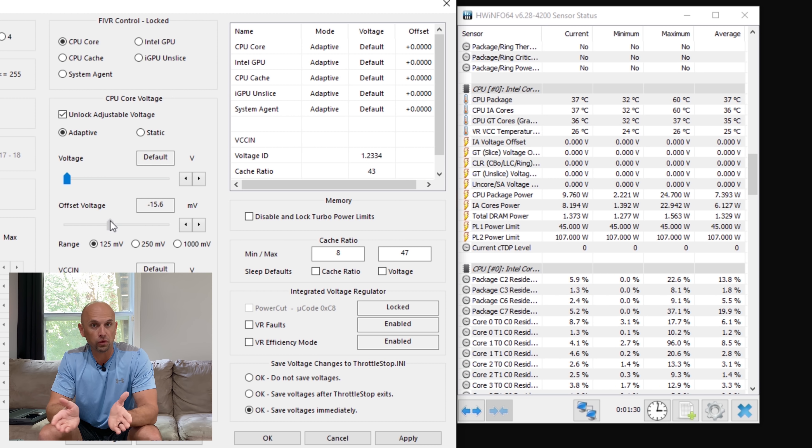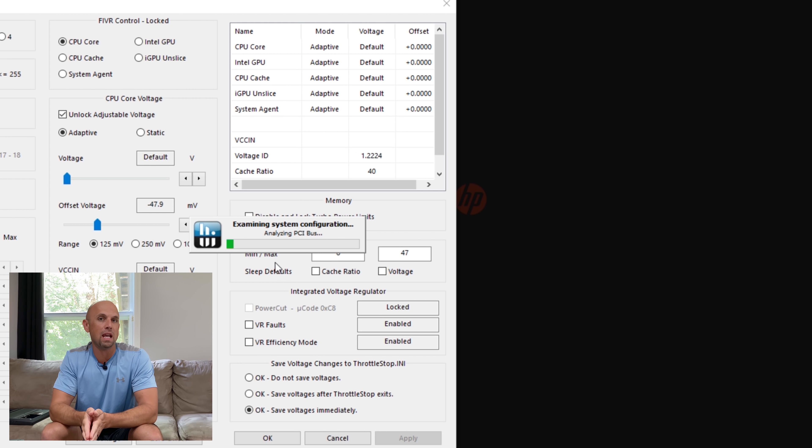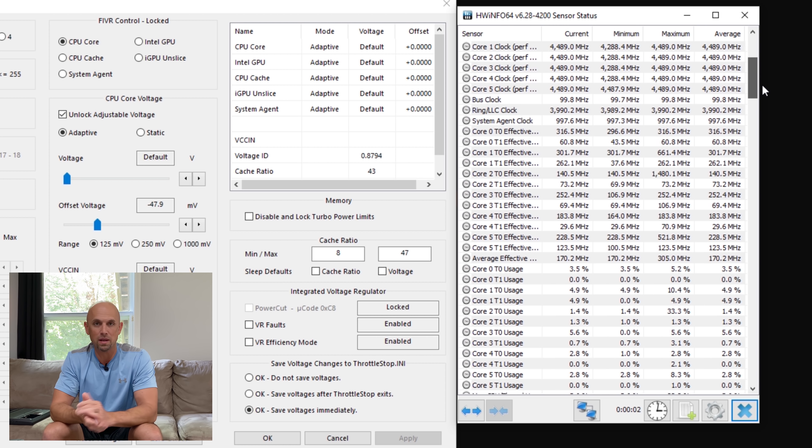So here's a few things that you may want to try doing. Try downloading Throttle Stop — I have two tutorials covering this on the channel, and I will link those in the description below and at the end of the video. Within Throttle Stop you may find undervolting sliders, but you may be able to move those all over the place and they just don't do anything. That is the case on this HP Omen — it is locked out of undervolting. Despite being able to adjust them, there is no evidence of the adjustment taking effect using software such as HWiNFO64.